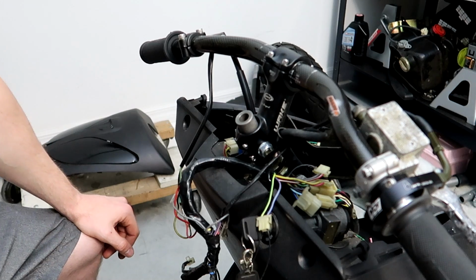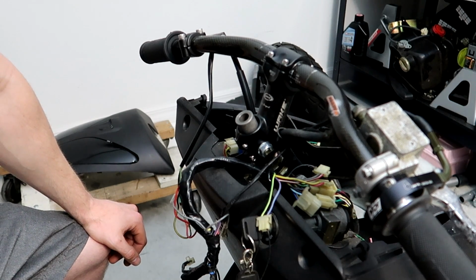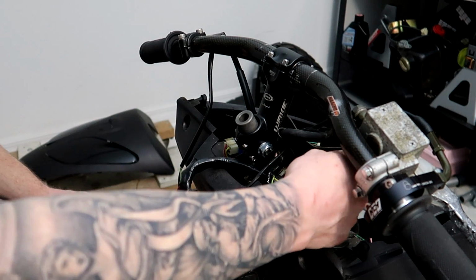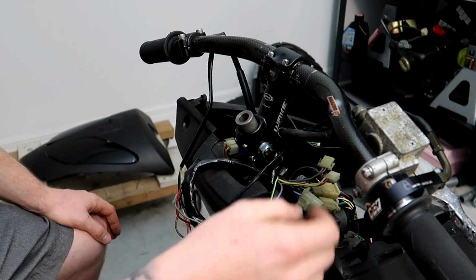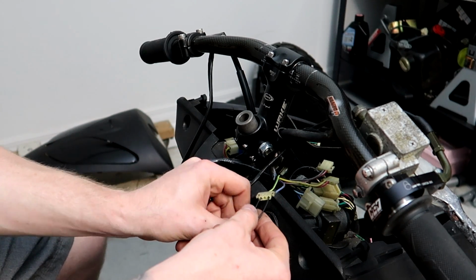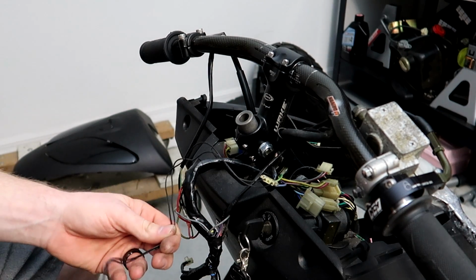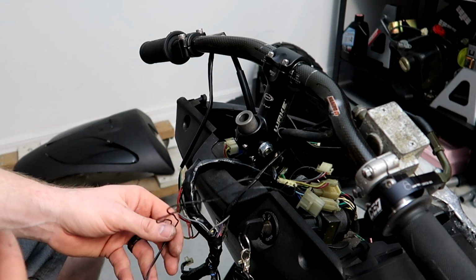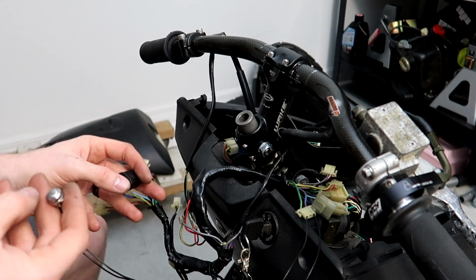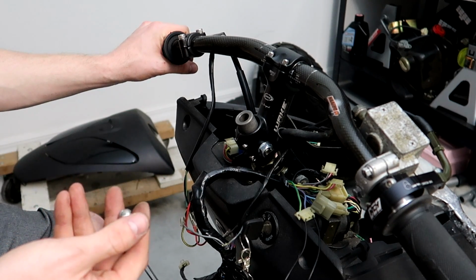I started having it going, and then the garage door opened up, the wife came home and scared the crap out of me. I took the front panel off here because there's more wires in here that I completely forgot about. I was about to put it in the wrong setup, so with this, that brake switch is stuck on right now, so it's almost as if I'm hitting the brakes. The kill button is in, or the bypass, so if I hit the start button, essentially it should kick the start over. Hopefully.